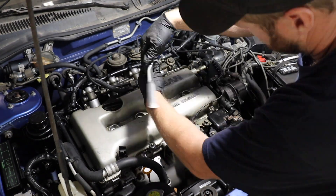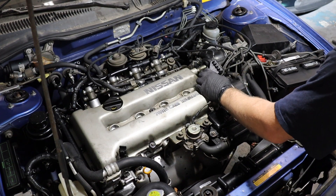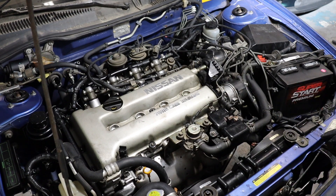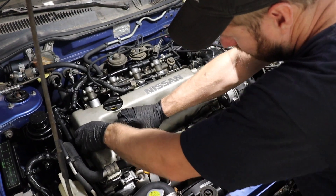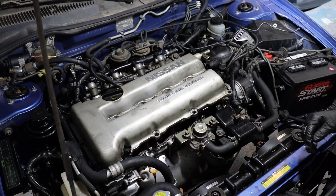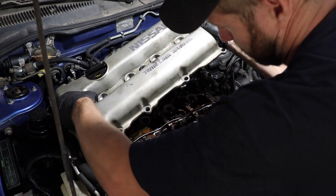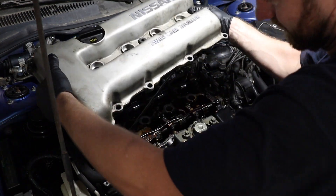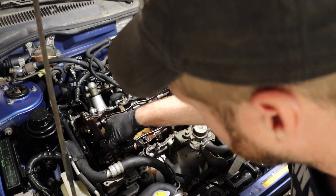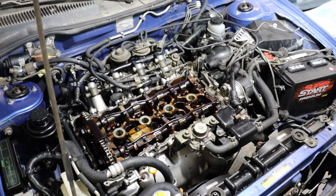It looks like there's going to be quite a few of them. It's been quite a while since this valve cover has been changed — it's really on there hard. You want to give it some nice soft mallet hits. Nothing too hard — use a rubber mallet, obviously. This is thin aluminum. Once it starts rocking, we're in a good spot. I disconnected this little hose here to get that out of the way — there were some clearance issues. Oh my God, look at the old gasket just sticking to it. We got our half-moon sections on the sides of the cams here. Yeah, this is a very old gasket. Out it goes.